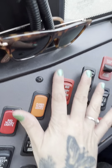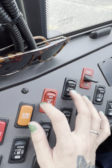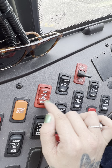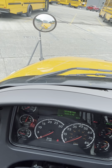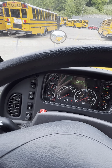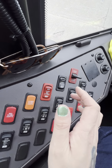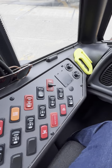Over here, next to the switch that opens our service door, is your amber warning lights switch — it says 'override.' When you turn your ambers on, you want to look in your crossover mirror out here and verify you can see them flashing before you say you're testing them. Sometimes when you hit this switch it doesn't actually turn them on, so you need to make sure you hit it right and double-check that they're flashing.